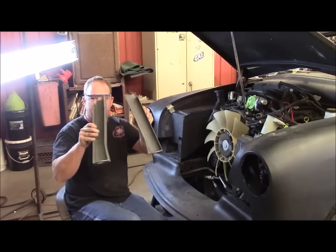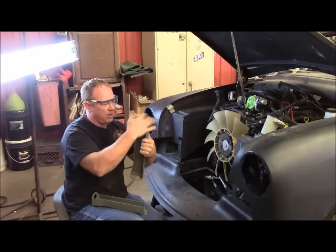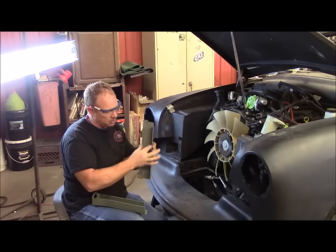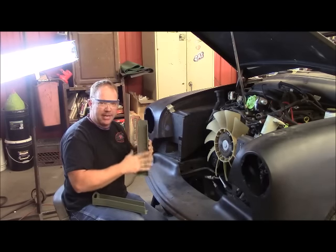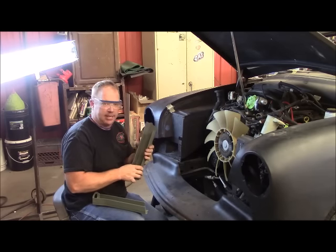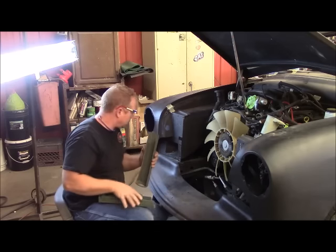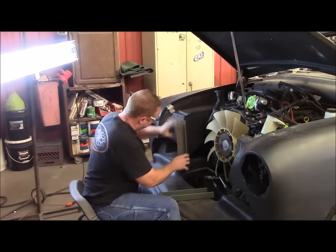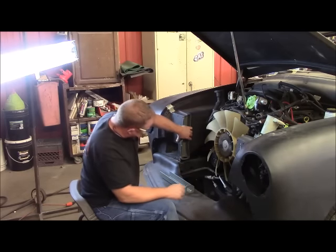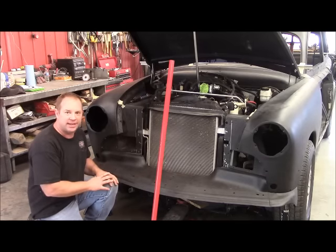Here they are - look pretty nice, don't they. Once I get them installed I'm going to weld them in and plug weld them, then come back and add some supports between here. But I won't put them in yet because I'm going to design something around your radiator - probably right at your mounting brackets - and then turn them into the supports. That's kind of how it's going to look. Alright Bruce, I've made a little fork in the road on your front end here.